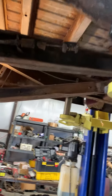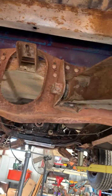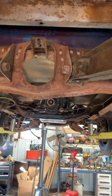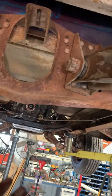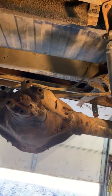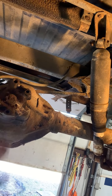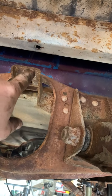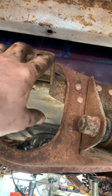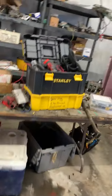One of the things you're going to find on these old trucks is the carrier bearing — it's mounted right here in this transom in the middle. Those things are usually toast. You got a drive shaft that connects here, one goes to the transmission and the other to the differential in the rear. We're going to pull these four bolts out to get the u-joint free, and then at the top of the carrier bearing you got a couple bolts holding that in, and slide that out the back.